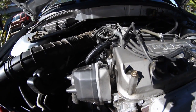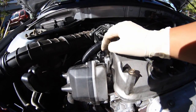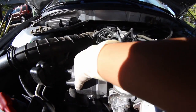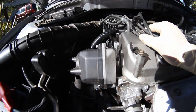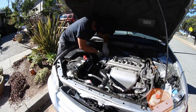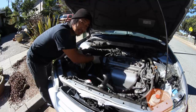In that instance, you need to mark with paint or a Sharpie the original position of the distributor, right here, because by rotating it you're adjusting the timing and you want to make sure you put the distributor back in its original location. Or if you have a timing light, you can use that as well before you remove the distributor.